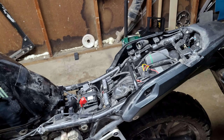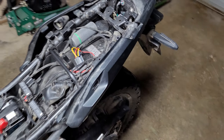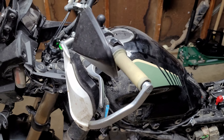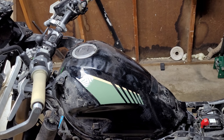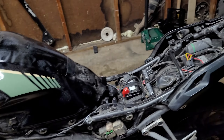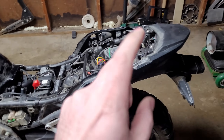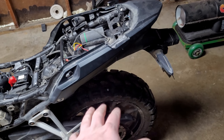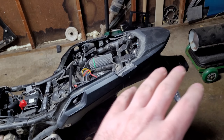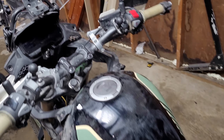That's not very handy if you want to do it without taking the seat off, so today I'm going to show you how to put a switch in. There is also a zero-cost method using the plug under the seat. If the ABS is not sending the correct count from those little holes, it throws a fault code and shuts the ABS off completely. You can't turn off just the rear ABS — a lot of off-road people want that, but it doesn't work that way on this bike.